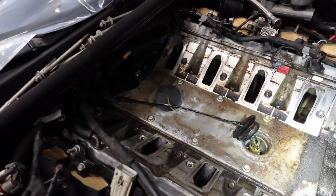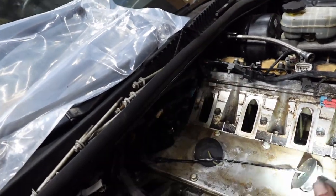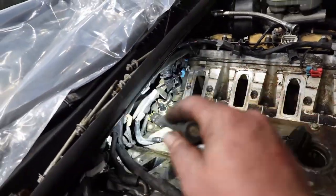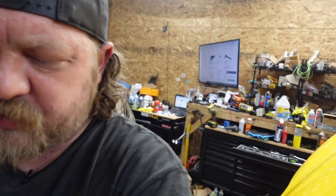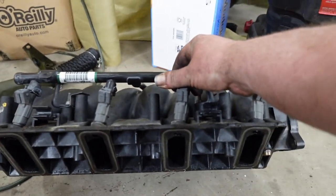But I'm gonna clean all this up, reseal the plenum or the valley gasket. You gotta knock out the knock sensors under here. But yeah, we'll reseal this, reseal those, and I'll at least be more comfortable knowing that the top end's been gone through and it's new stuff. Because on the intake, like I said, you could tell by me taking it off and even seeing witness marks on things, they look like they reused the old gaskets. Now don't get me wrong, they are reusable, but if they're set from 2002, they're bad by now.